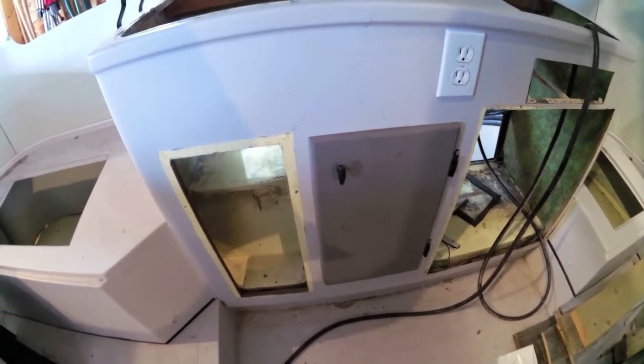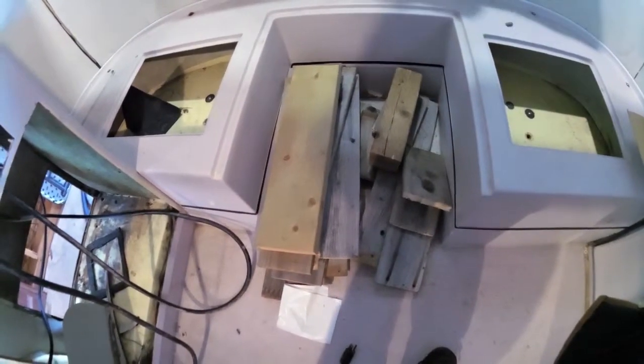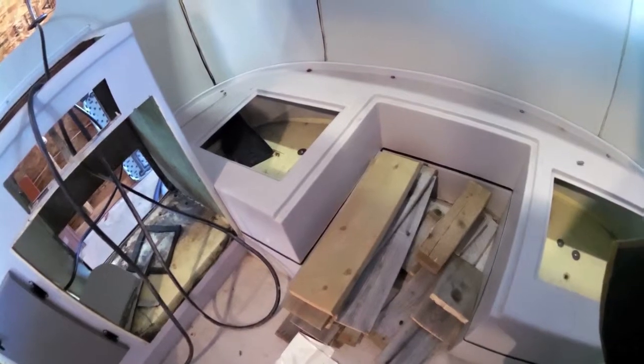That's why I put the self-tapping screws back in similar spots where they were. They went down through the frame. We tapped right through the steel. These bolts are on the frames. These corners there, you can see the plate where the bigger washers are. There's a plate, a piece of flat stock that goes off the frame itself. Oh, okay. 4 bolts in each corner. And then the rest, they went right down the frame rails with the self-tapping screws.